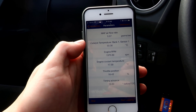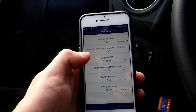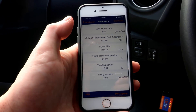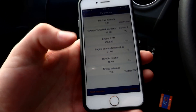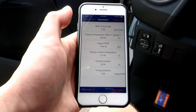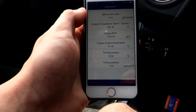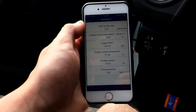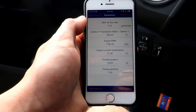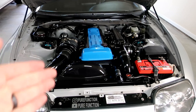Right now it's showing that when the car started, throttle position was at 18%, engine coolant at 17 degrees Celsius, live engine RPM, and then you can check the dashboard when done. You hit stop logging, check the flow rate, and change parameters. It gives you an exact readout of what your ECU is doing in real time. I can't recommend this thing enough — it's very cool. I'll list where you can get it down below.